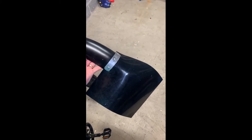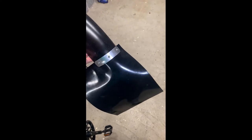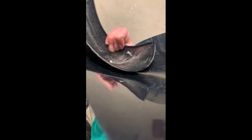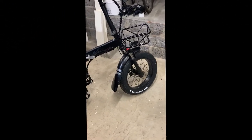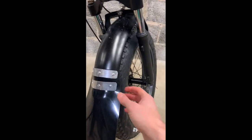I've assembled the first row of rivets and the rubber sheet, and I'm gonna cut the rubber sheet when I have it in place so it gets a good length. The rivets are not protruding too much, so there's no big risk of touching and damaging the wheel. Now I'm gonna do the second row before I mount it back to the bike.